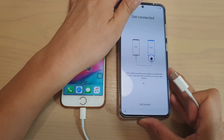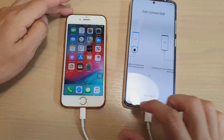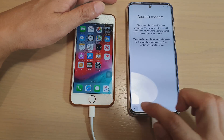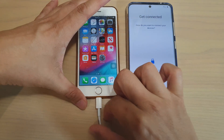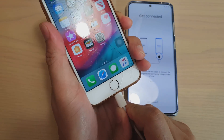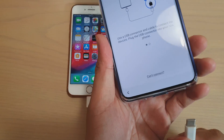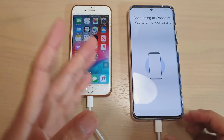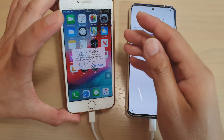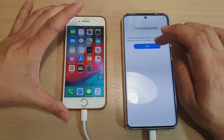Let's assume we're going to use the cables or the Smart Switch. I'm going to plug it into my Galaxy S20 Ultra, and the other end is plugged into your iPhone — this is an iPhone 7. If you see a 'couldn't connect' message, tap on back, make sure the cable is connected properly, and reconnect to make sure the port is in good order. Now it says 'connecting to iPhone or iPad.' If it does not work, make sure you re-plug it really tight. Tap the trust button on the iPhone and then back on the S20, tap on next.